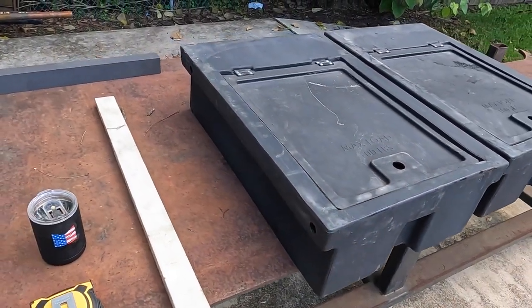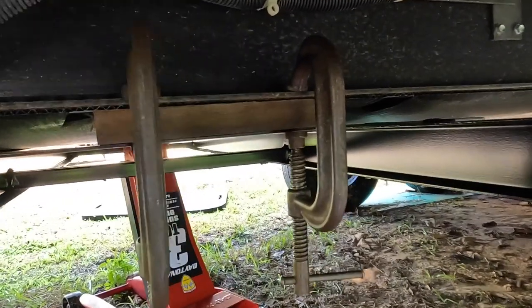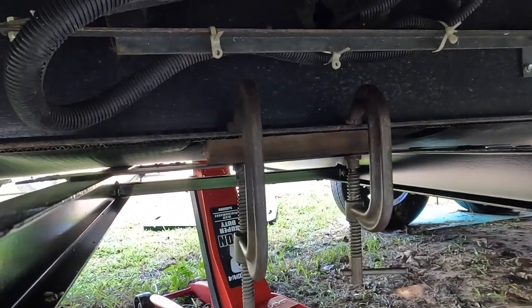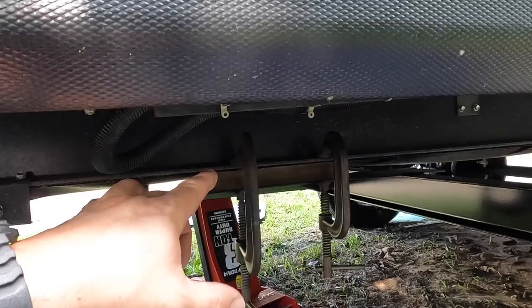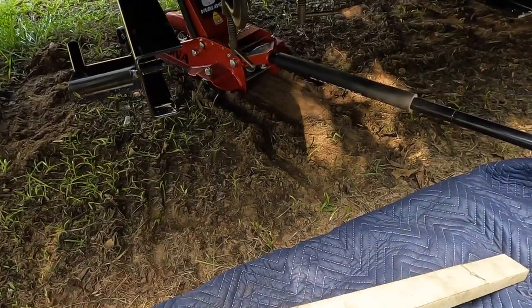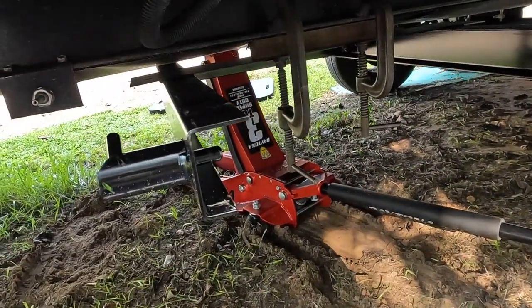Now we'll go check out the frame that they mount in. All right, so we're over here on the driver's side, and I've got a phenolic spacer in there. This is some stuff that I had already in a storage bin, and I'm using that. That's gonna be spacing this side off, but I've only got three of those, so I'm gonna use two on the other side. I've got this piece of 1-inch thick nylon that I can cut to length, and we'll use this on probably this side here. That way it'll span the entire length there and space it out.